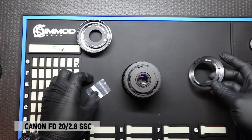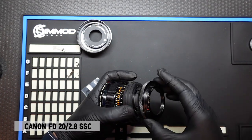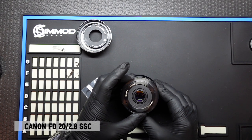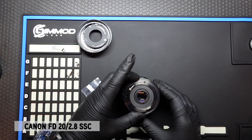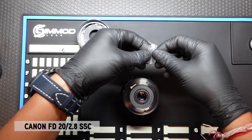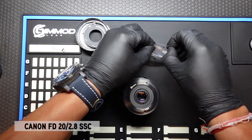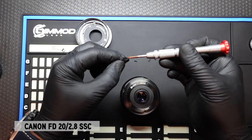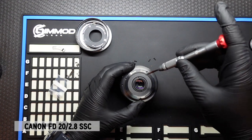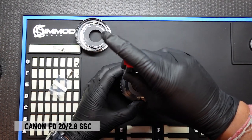Once that's aligned and the aperture is opening and closing, we're going to identify the center top of the lens and the logo on the EF mount. Slide that in and realign the holes. Using the supplied screws, we're going to replace the screws. We do supply four screws, but three are needed — the fourth one is a spare should you require a backup. We do recommend a thread lock on these screws if you'd like.